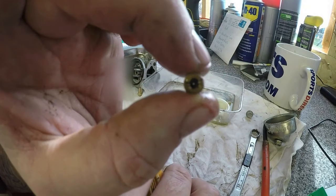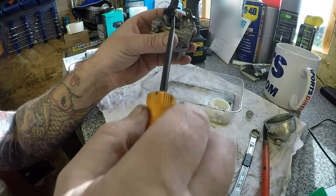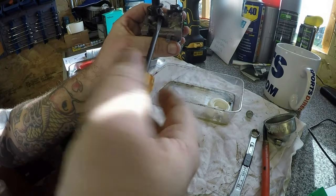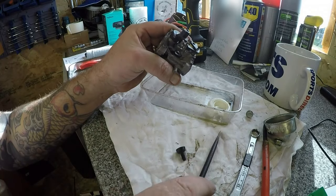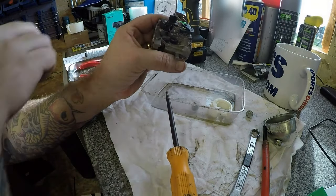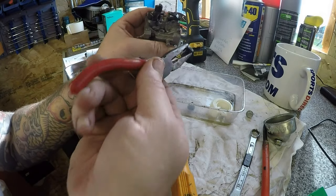The main jet itself is actually quite clean — however it's not as clean as I would like and the hole should be slightly bigger. I'm just going to ream that out very slightly. There are a few metal filings in here as well. This carburetor is nearly all apart — I just want to take this emulsion tube out. Measuring the depth — about three and a half. That one comes out. Then this pilot screw here — very gently with a screwdriver, just tease it up. It's only plastic so be careful. Get hold of it with long-nose pliers and tease it out very gently — it's got O-rings on here which you don't want to damage. It's quite dirty in there too — that's got to come out.